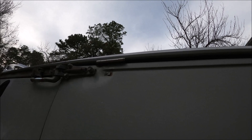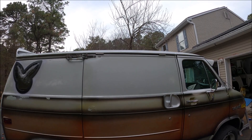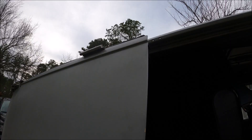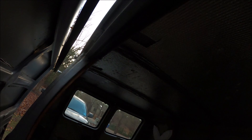The hinges are up, all mounted to the door, and the door is still functional. With a little bit of love she's gonna lay up in there perfectly. We have the filler plates welded in front and back. We also took off the rear striker — not sure if we can use that later — and took off the front one as well.